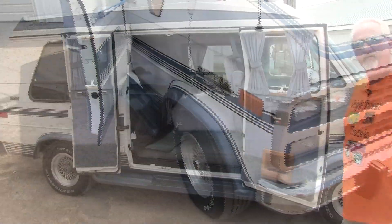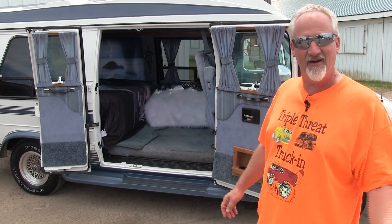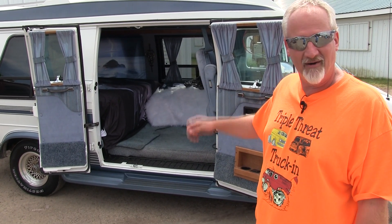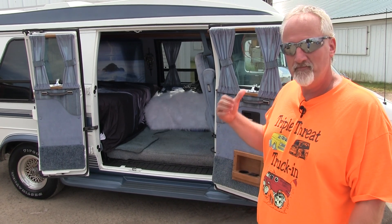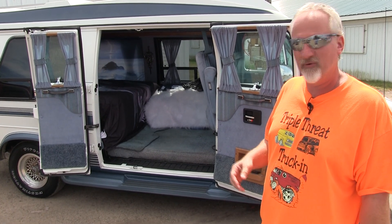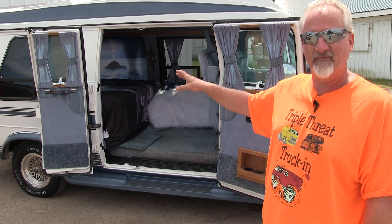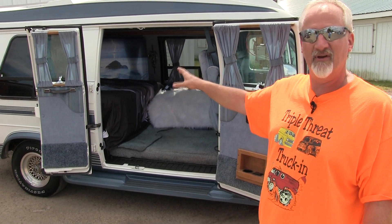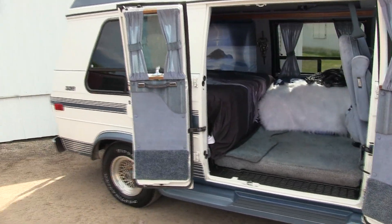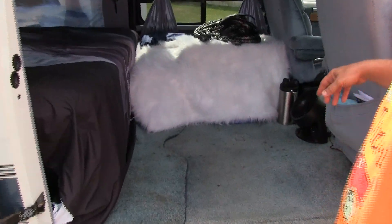I've been watching a lot of videos from JJ Lightning - he's been giving me a lot of good tips. We tried running an AC unit inside and it's good for camping if you've got the power, but our 3,000 watt inverter just wasn't enough. It was draining the batteries even with the alternator running down the road, so not the best idea. For now we just run a few fans inside.